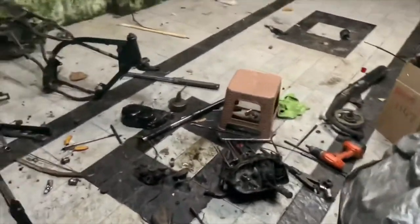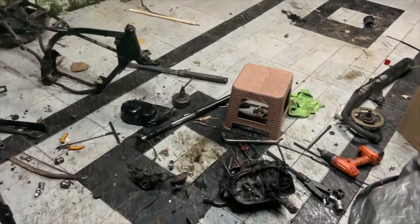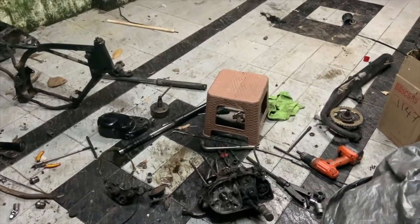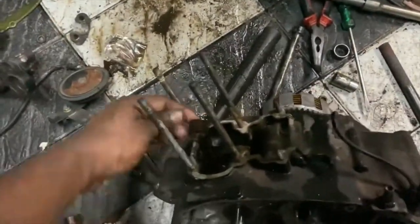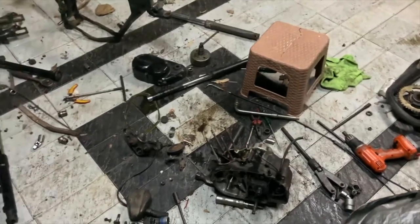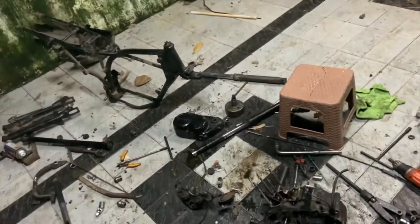For the Shogun engine, I want to get the oil seals and bearings sorted and then take the engine apart. I don't want to unnecessarily disassemble everything since there's nothing in the engine that needs zinc dipping. I checked the crank right now and there is no play, so most likely we don't have to rebuild the crank — but once we take it out we'll check again. The noise was most likely coming from the top end bearing which is dropping a couple of needles, so that's in pretty nasty condition and will need attention.